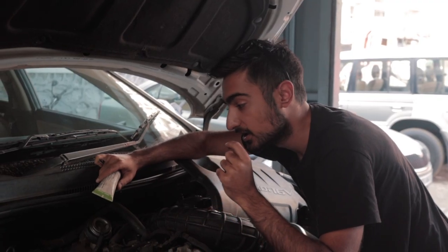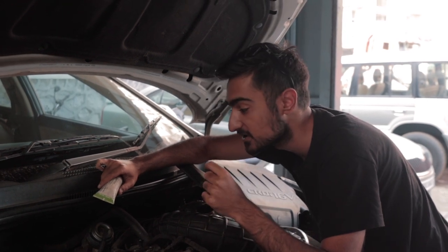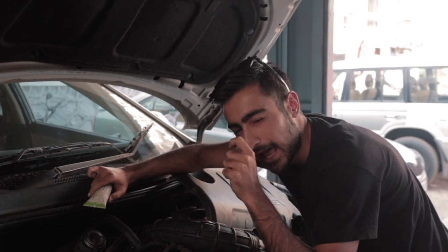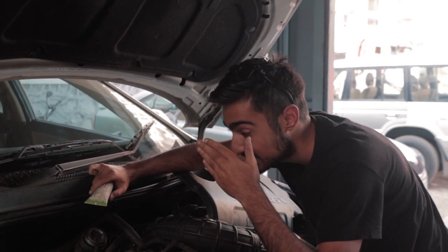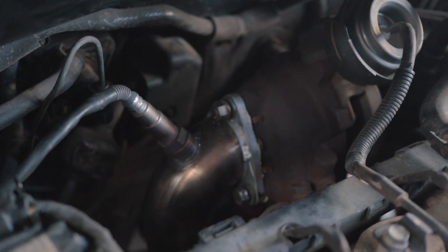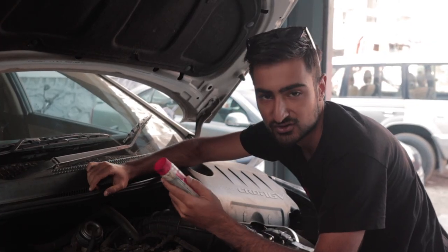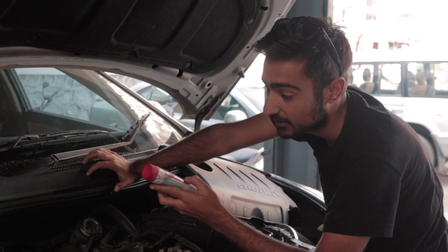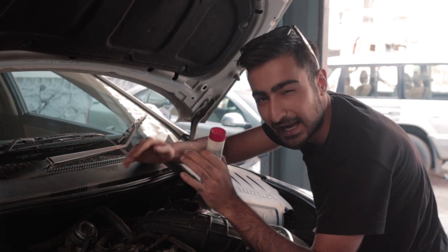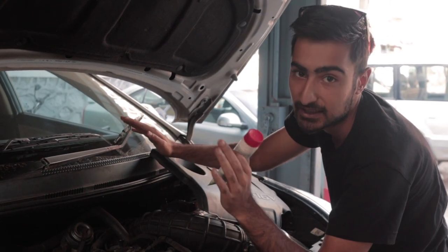We have just fit the downpipe back again correctly with no leakage, because we found the problem — it was a gas leak in the gasket. What we did was hammer the gasket so that it's completely flush with the downpipe and the exhaust manifold, so there is no space and no gas leaking. And because it's not going to seal just with a physical gasket, we needed to use an exhaust system fitting paste that solidifies and completely blocks the gas passage so there is no leakage.